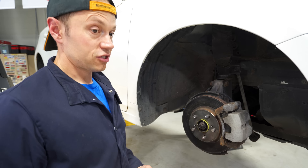After getting this car outside and looking at it, I think the 15mm was the way to go. It certainly looks so much better. I could have gone 20 or even 25mm, but that would have been the stance life — not appropriate for a daily driver. Having that front lip on the front of the car, it looks good. I'm actually proud of this vehicle. The one remaining question is whether the steering wheel or the car is going to shake on the highway at 60-70 mph or 100-115 km/h, where you typically get shake with wheel spacers.